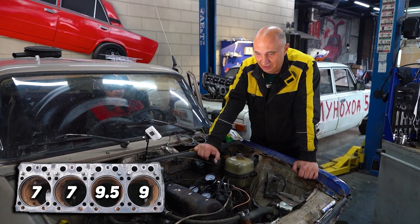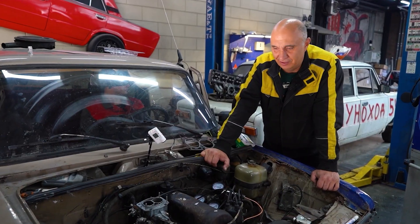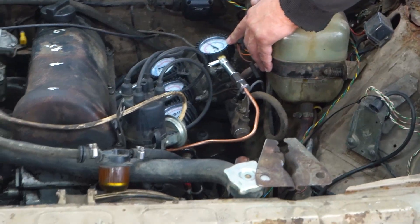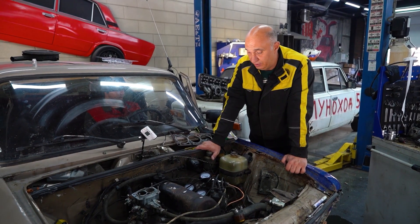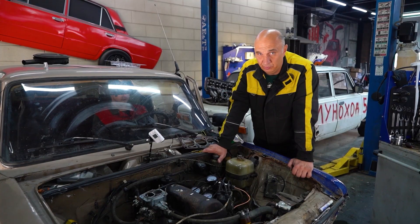Some sources indicate that the pressure generated when the mixture ignites and explodes is anywhere between 36 and 60 kilos. We're very curious, and now that we know the compression is going to be higher — the pressure will be in excess of 16 kilos — that's the highest number these manometers can show. So let's replace them with a set that can withstand much higher pressure: instead of 16 kilos, something rated at 160 or 100, whatever we find. Let's replace them and try starting the engine.